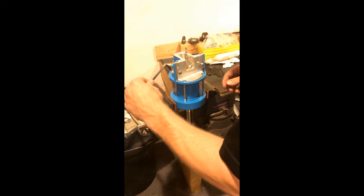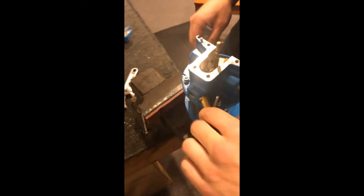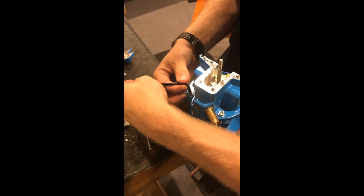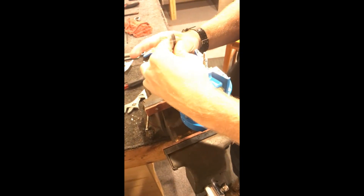You have four bolts — two in the back, which are both 5mm Allen bolts, and two in the front that are 4mm Allen. Those can be a little tricky; you have to be careful you don't strip them out. I've used little vise grips in the past to initially break them from the threading before putting an actual Allen wrench into it.